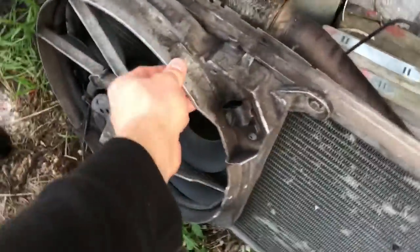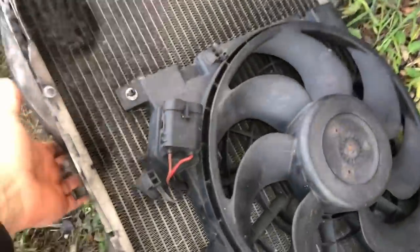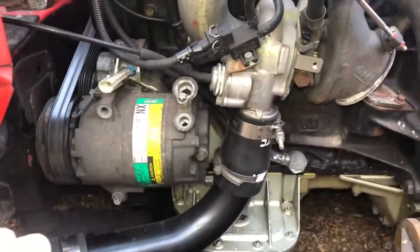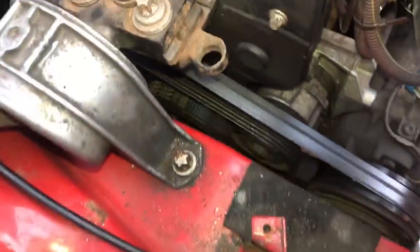Pulled that out — you can see the size of the standard fan; it's enormous, so it's going to look a lot more compact with the new setup. That's the aircon fan too — that's really not needed on there. The alloy setup with the new fans will look a lot better. While this is all apart we're going to get rid of the aircon: remove the pump, the tensioner, and take off the crank pulley to fit a new lightweight one. Get that belt off.